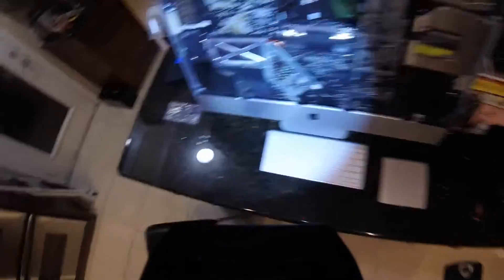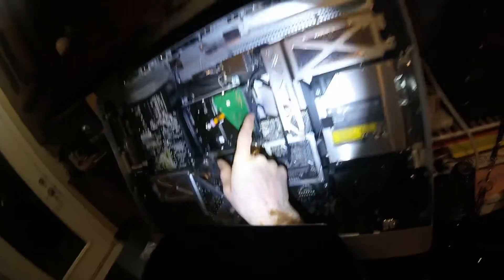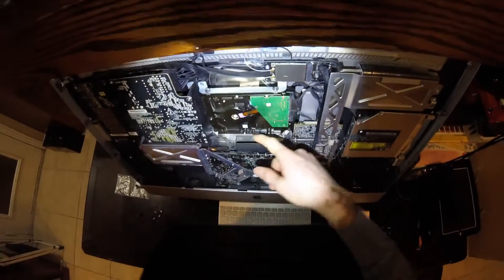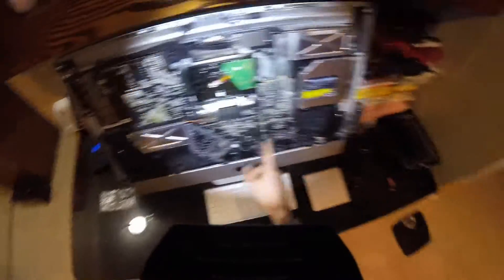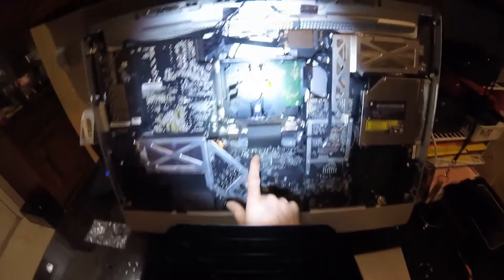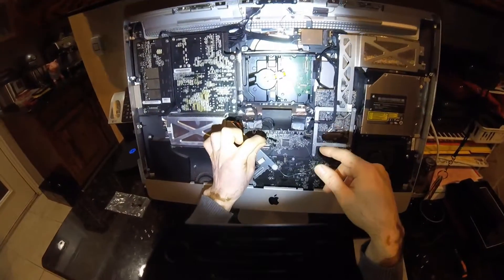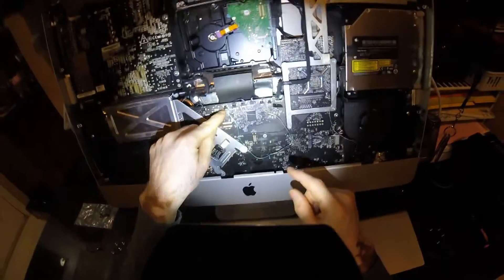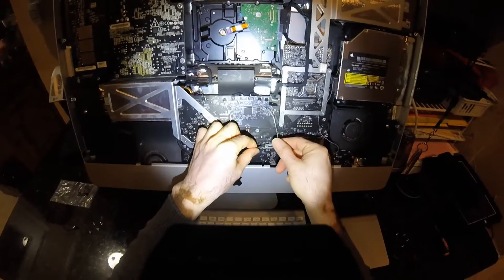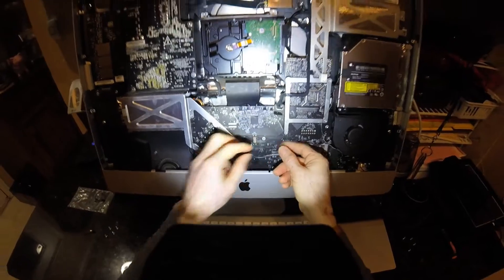Now we are at the fun part. That is the hard drive, and this is supposed to be a temperature sensor connector — but it turns out for the Seagate, they probably didn't enable it in the firmware. As you can see there is an air gap, and this blower is actually coming from one of these two fans, so there will always be airflow going through the hard drive area. What we did is — this used to be a connector labeled 'HDD temp' — I disconnected the original cable and simply used the terminals below the connector to solder a couple of thin wires, then added a 1K ohm resistor to fool it into thinking the hard drive temperature is completely normal. I used a little heat shrink wrap so I don't short anything.